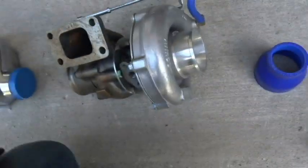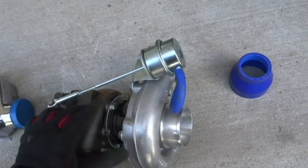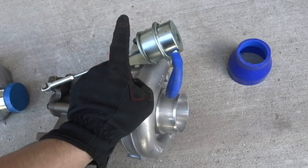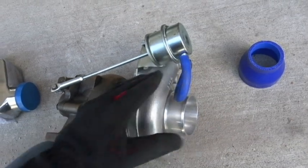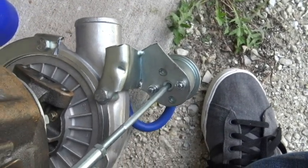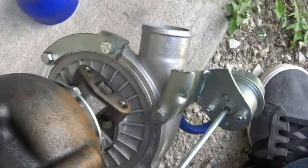Since it was an internal wastegate, it was being a pain trying to line it up and position the compressor housing in the right direction. If it faced forward it would hit the radiator, if it faced back it aimed toward the engine, and facing up the radiator hose was in the way. The only option was facing down, but the compressor housing outlet was in the way of the wastegate, so I had to cut it off and bolt it separately, angling it up a bit.